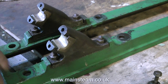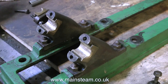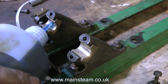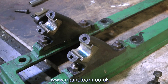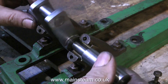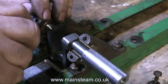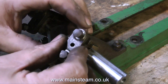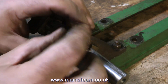And now it's time to put the whole thing together. First thing to do is to oil the bearings thoroughly — this is some oil that I use in my airline, which will do the job for the moment. Plenty of it everywhere. Then I'm putting the crankshaft in position and carefully nipping up the top caps. These bearings are not perfect to say the least, but they'll do the job, and they are adjustable, so I'm able to get a nice purchase on the crankshaft to stop it wobbling about.